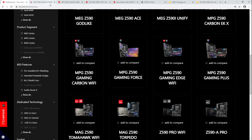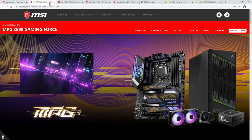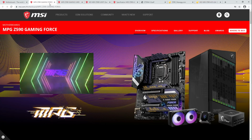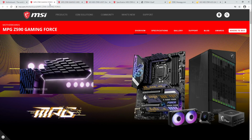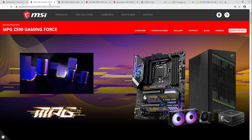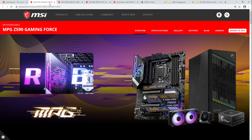the Carbon ended up being my go-to. I don't want to go out and buy an Apex or a Dark or a Tachyon, but I do still want to do a bunch of overclocking, and I like RAM overclocking, so I kind of need a postcode, because without a postcode, life gets kind of... Especially on Intel platforms, that postcode can help you troubleshoot quite a few different issues. So for that scenario, that would be a great board.